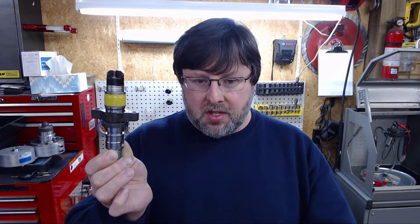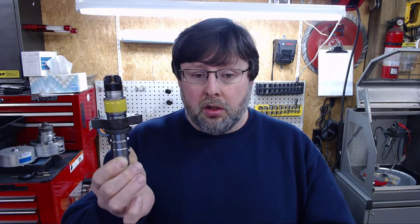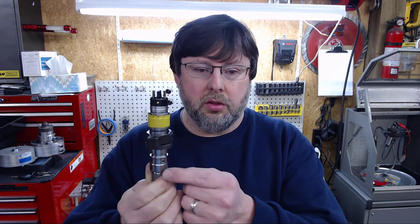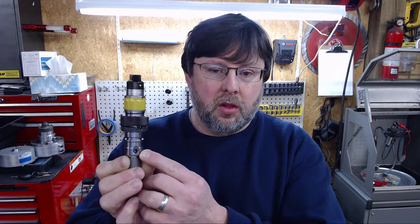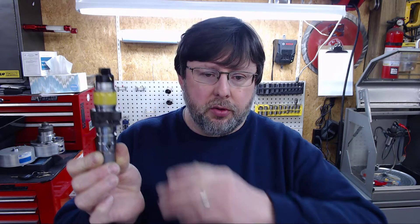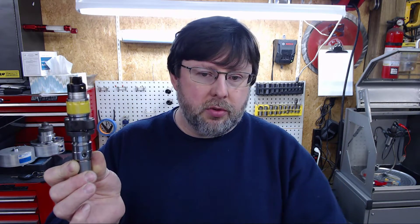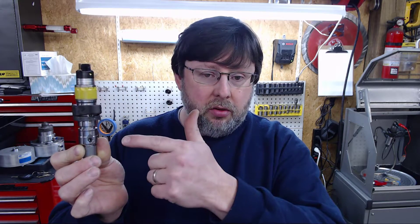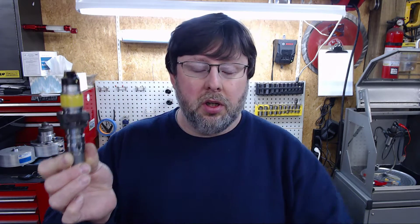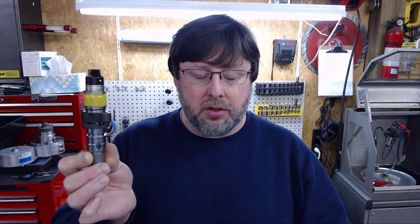This is the life of your engine. If something happens here, you're going to be putting an engine in your vehicle — and it's predictable. Consider if you get a chunk of debris in this fuel inlet and it fouls up the passage for the control valve. It's going to be free to do whatever it wants, and as long as pressure coming in is greater than the spring pressure holding the nozzle closed, it's going to go wide open and you'll be pumping 200 milliliters of fuel into your combustion chamber in just seconds.